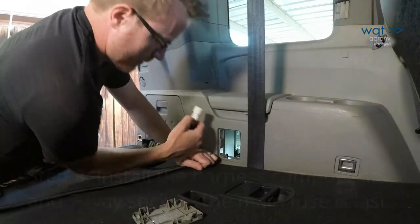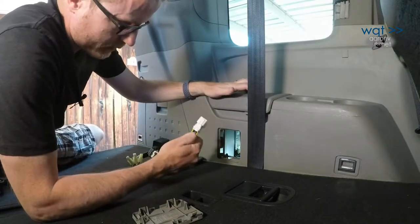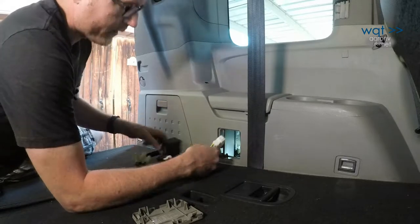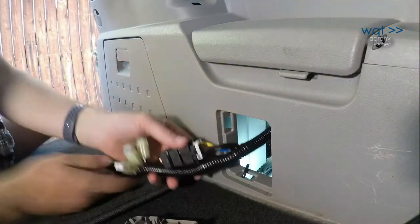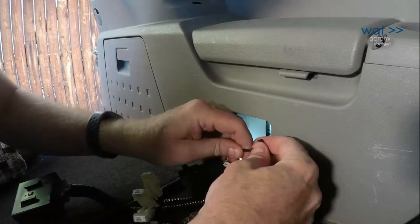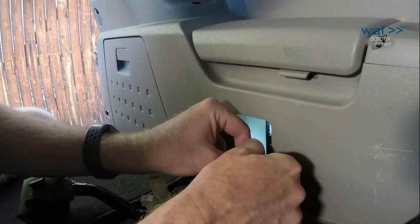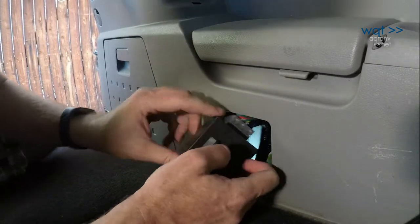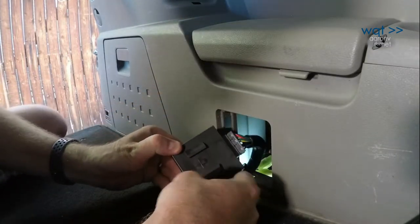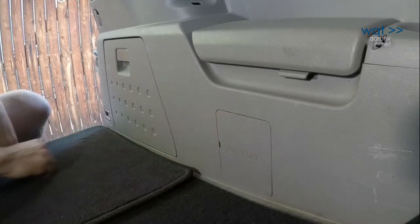The second step of the install is to get in here, hook up this harness, plug in this box to the slot tab, and do any necessary wire tying. We're definitely going to want to plug this plug in first before trying to clip the box on — otherwise there's just no hope of getting to it. I heard the click — it's in. I'll take one of the provided zip ties and just secure this down so it's not flapping about. The main thing we don't want to do is pinch the wire so close to the end of the connector that it starts to tear them out. Now we work all this down in there — it slides onto there. The plastic molding doesn't quite line up with the tab correctly so it won't snap in, but there's enough friction on there to hold it in place.